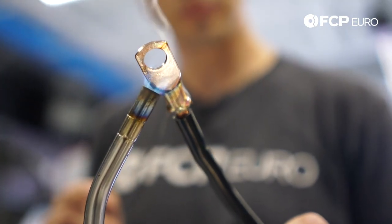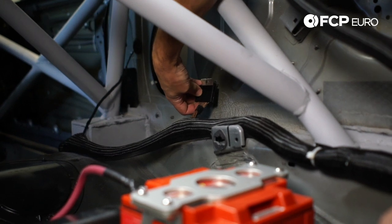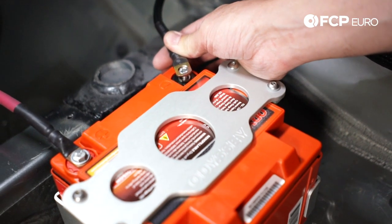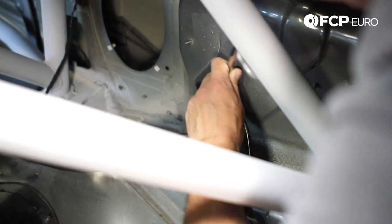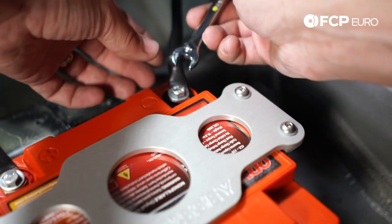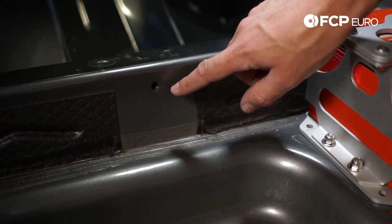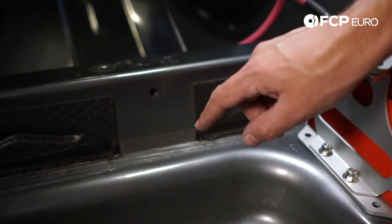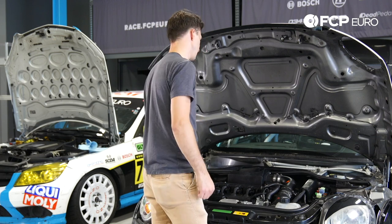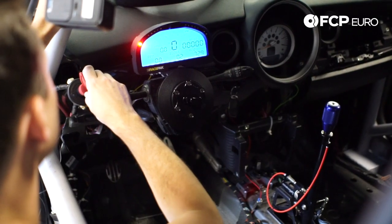Here's the repurposed ground wire — we changed the end on it to match up with this battery. What we're doing is going into this ground right here which already exists — you can see it's a big ground with a bunch of wires grounded on it — so we're going to use that as the grounding point and then run directly over to the battery. As soon as we touch these together we're going to close that circuit all the way up to that switch. If you don't have a ground right next to where you're working, you can make a ground anywhere on the car since the whole chassis is ground. Just make sure you take a grinder and grind it down to bare metal around that point because you want metal-to-metal contact, or else you're not going to have a strong enough ground. Now that we have the battery completely tied in, we have a circuit — the switch is cutting it off right now, but we have power going to the whole car. When I turn this off we should see everything shut down — just like that — so we know the switch is wired correctly.